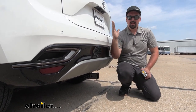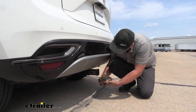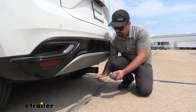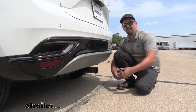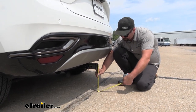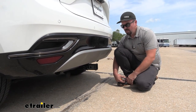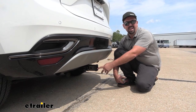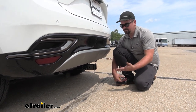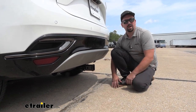When choosing accessories like a cargo carrier or bike rack, they can get pretty close to the fascia, and when choosing a ball mount you want to make sure it sticks out far enough to hook up to your trailer. Measure from the center of the hitch pin hole to the furthest point of the rear fascia — this one comes in at about five and a half inches, so you may want a slightly longer shank. As far as ground clearance, this one comes in at about 12 and a half inches, which helps determine whether you need a rise or drop for your ball mount. Also keep in mind that suspended accessories extend the vehicle and can tilt toward the ground on steep inclines.